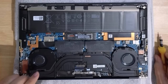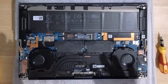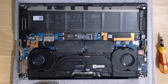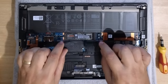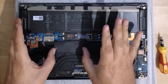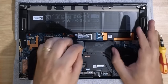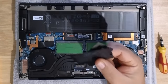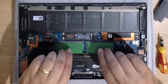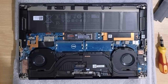The second thing we're going to do is update the RAM. There are two memory modules. I purchased this laptop with 16 gigabytes of RAM DDR5, and I'm going to upgrade it to 64. There are these almost paper-like covers over top of the RAM, but you'll see the retaining clips — you just push them out and that should release the RAM from the clip. You can remove these; I'm not entirely sure why these are needed, but I'll put them back just in case they provide a function.